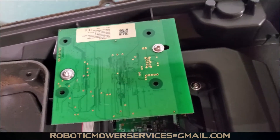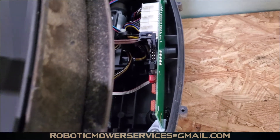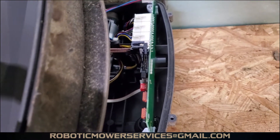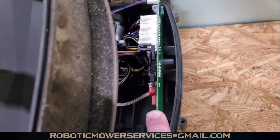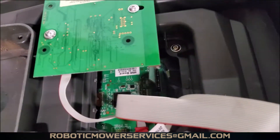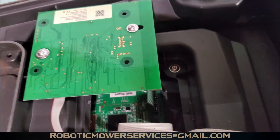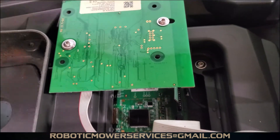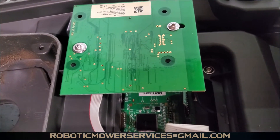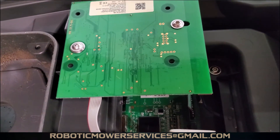On the app we can see where the mower is mowing in our backyard. However, when you install this in a 310 or 315, it does not allow you to use the GPS mowing feature, because the motherboard is told via serial number that the feature isn't available. The same motherboard is used in the 310, 315, 315X, and 315X Anniversary Edition, but it knows what it's allowed to do based on a serial number the dealer enters when programming it.